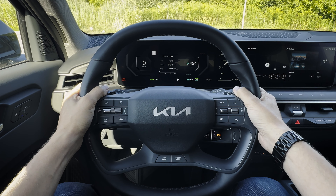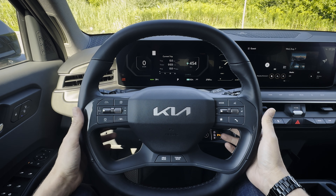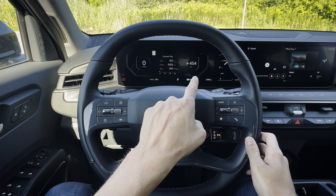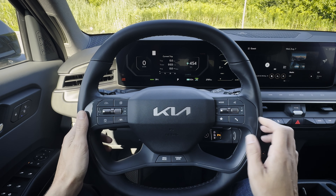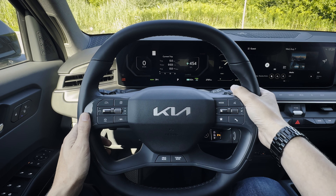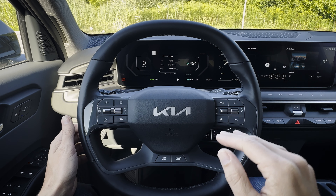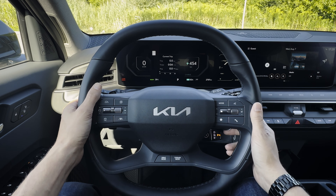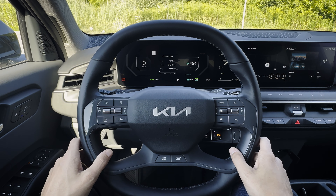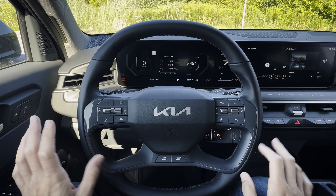You've got your regenerative braking paddles — plus on the left-hand side, minus on the right. It works differently in EVs compared to internal combustion engines. If you go up, you'll max out at I-pedal drive, which is one-pedal drive — take your foot off the accelerator and the car slows down very rapidly. Versus level one or level zero, where you slow down more gradually, more like a traditional gas engine feel. I personally recommend usually being in level two or three, unless you like that one-pedal drive feel where you also capture the maximum amount of charge as you go.